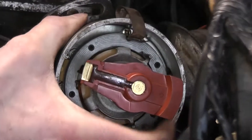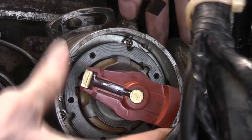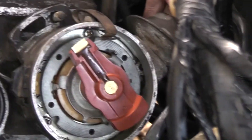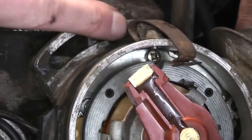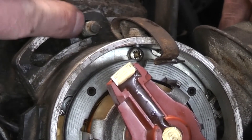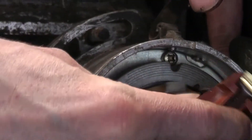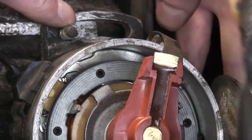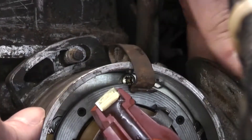Drop the distributor in. As it catches on the camshaft, catch the tooth. Although I could line it up there and that's pretty much lined up, it gives me no adjustment. We need to get the lock-down stud somewhere in this crescent. If I went too far the other way you could just about line it up, but again it gives you no adjustment. There is a happy spot — getting it in the right tooth.